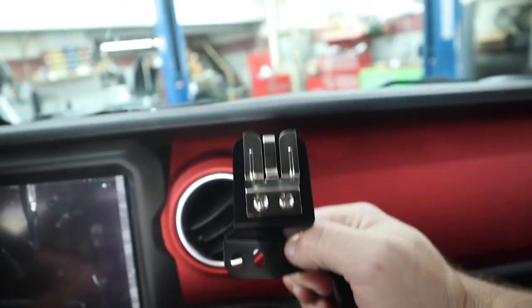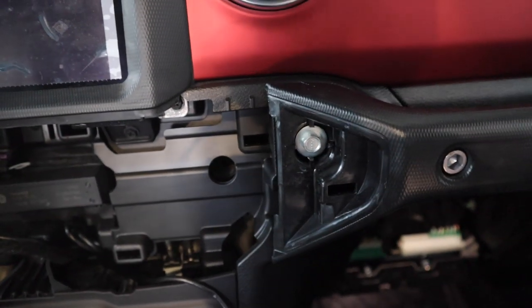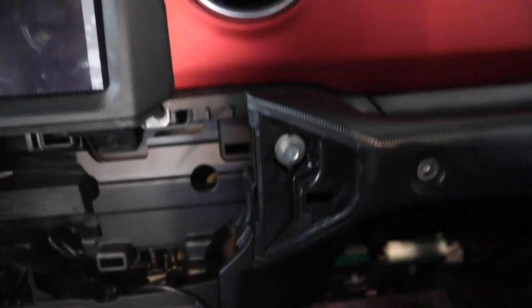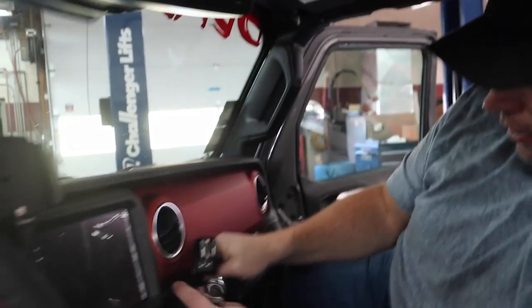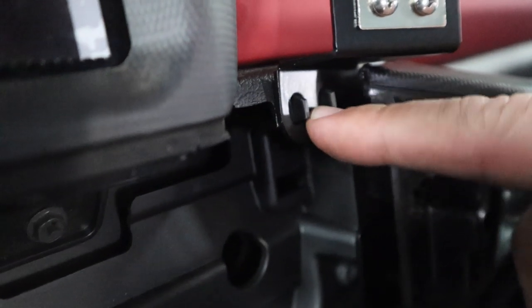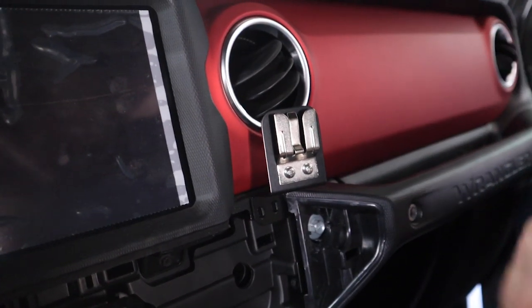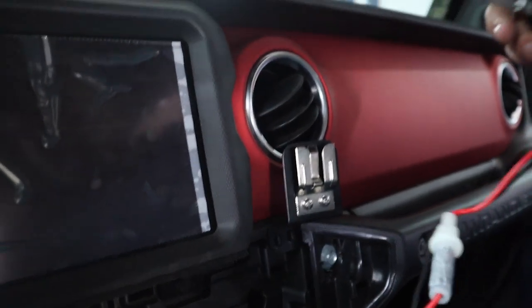I'm going to install this. I installed the mic clip to the mount already to make it a little easier. This is a 10 millimeter bolt — you're just going to remove that. It's a 10mm. We're going to remove this real quick and slide this in and get it all bolted up. There's two holes right here; you're going to line these up with these two little notches. Then you're just going to tighten this 10 millimeter bolt back down. The mic mount is installed. You won't even see any of this — it's going to be all nice and clean because we're putting that panel back up.